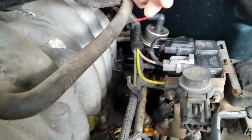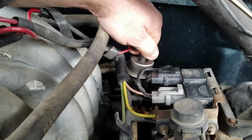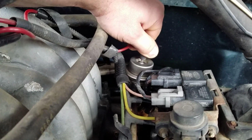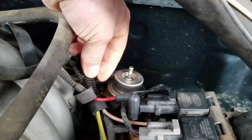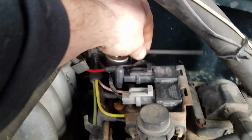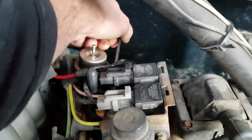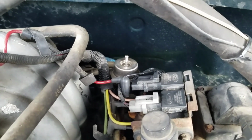So now that we've released any possible pressure in the fuel lines, again, be careful because this is a plastic vacuum line. So you can carefully wiggle this off without busting that vacuum line. Okay. And like I said, I already sprayed those to loosen them up. So I've got to remove these two bolts, and this thing should pop out. It's kind of a pain with one hand. Oh, alright, that wasn't actually that tight. Cool. Alright, I'll get this thing off here and show you what's next.